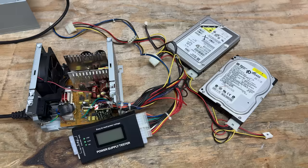That CD-ROM drive is made by TEAC, model CD532E, and it has a surprising amount of weight to it - hopefully that means it's luckier than the unlucky Gold Star. Manufactured June 1999. This itty-bitty power supply is actually a standard form factor known as SFX. Luckily I have a spare one of these sent in by a viewer - thank you very much, Jeffrey - so the show will still go on even if this thing is no good. Voltages are looking good. And that five minutes is up - nothing wrong with that power supply.